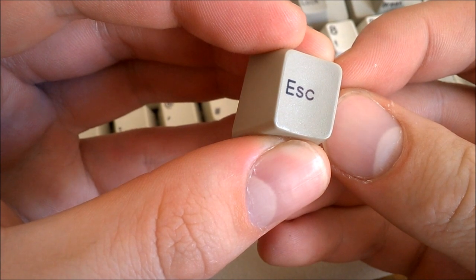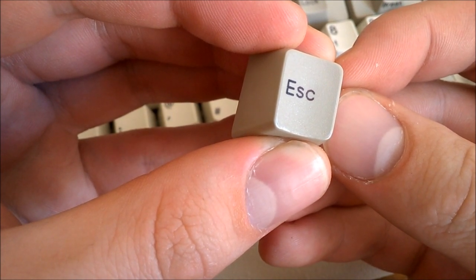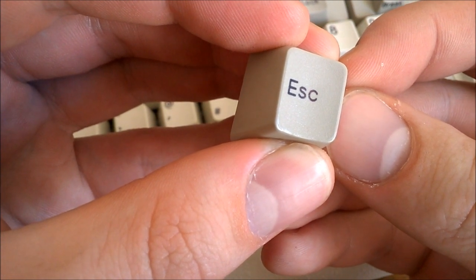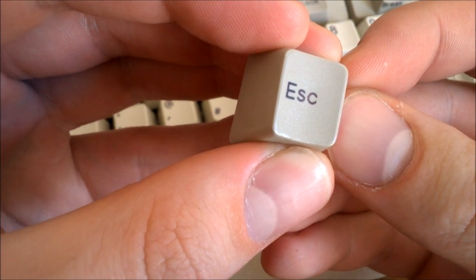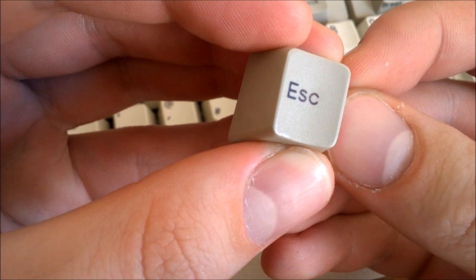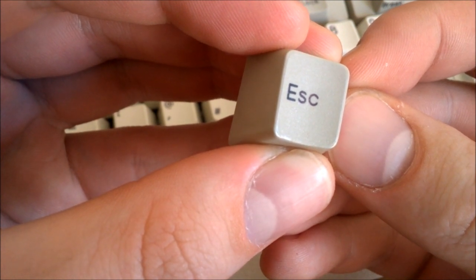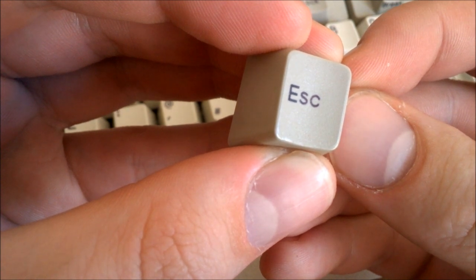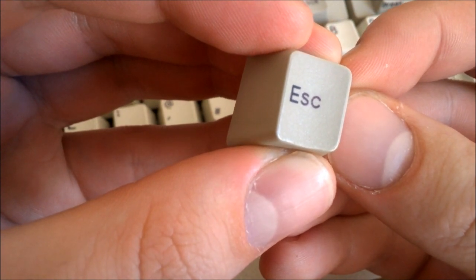Of course, PBT doesn't whiten upon exposure to the sun, but dye sub printing can bleach slightly over time, presumably also because of sunlight. You can't see it at all from a distance, and I'm not sure how well the camera is picking it up, but from close up you can just make it out. An unfortunate slight weakness of dye sub printing.